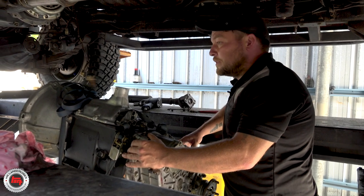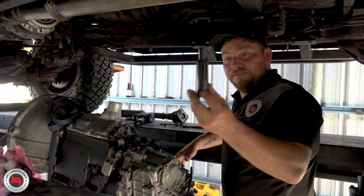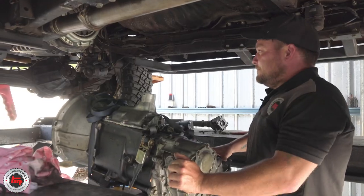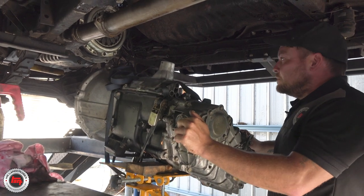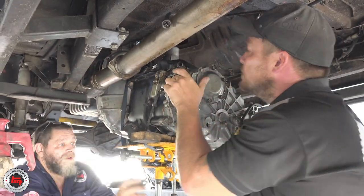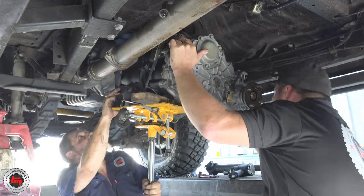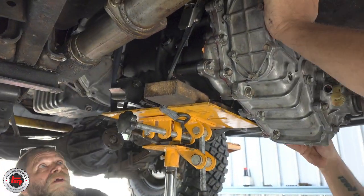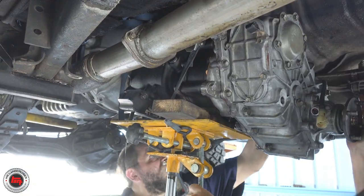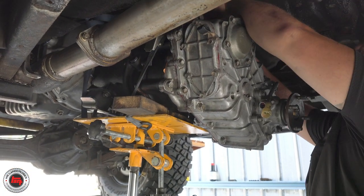Using the Terrain Tamer first motion shaft dummy for the clutch center. Famous last words - it should just slide in. I spent about two hours with my Holden gearbox the other day trying to do exactly this. Some are better than others. We're using a block of wood to try and get the pitch exactly right. You can never get it perfect - the splines are quite coarse, so you can be half a tooth out and it can give you a right nightmare.